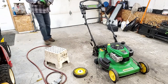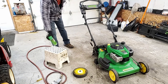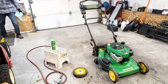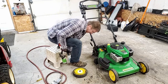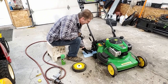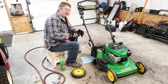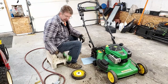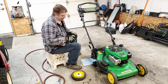on the gears, is a graphite. I'll put the link in the description for it. Just graphite on the gears. A lot of times from factory they don't put anything. You can't really use grease. If you use grease, what happens is it's not really sealed, and dirt and grass gets in and get into the grease, and then it will start chewing the gears right out in no time at all. So graphite is a dry grease after it dries up, and it still lubes it.